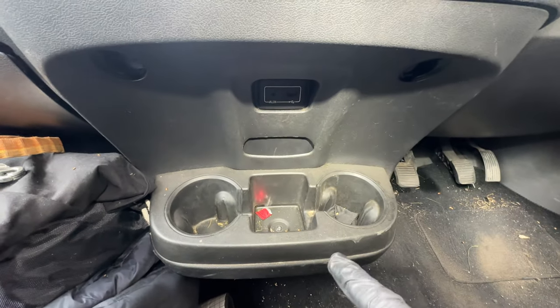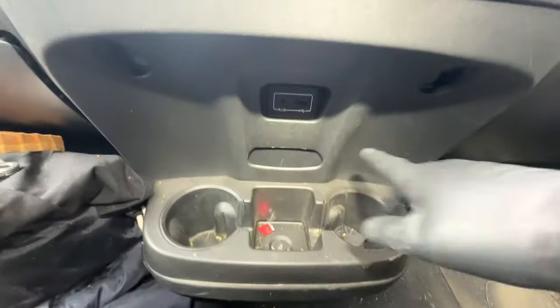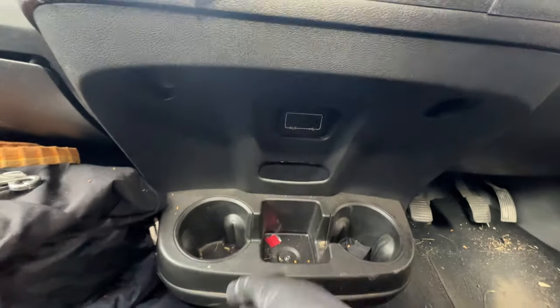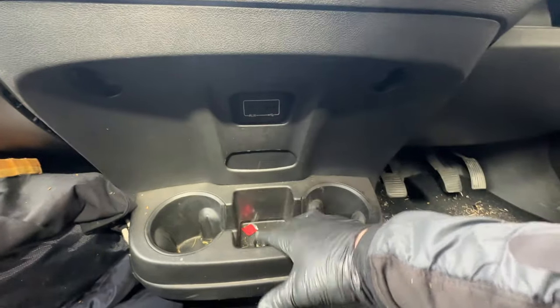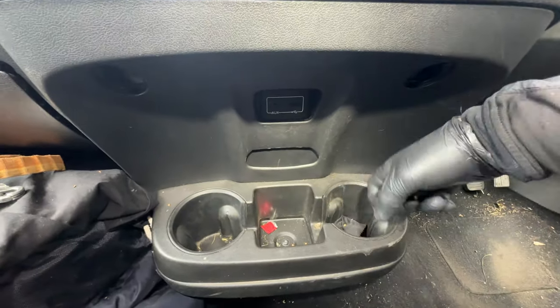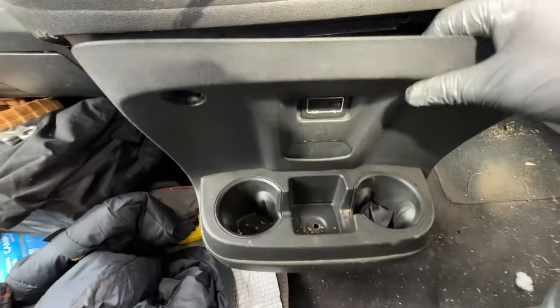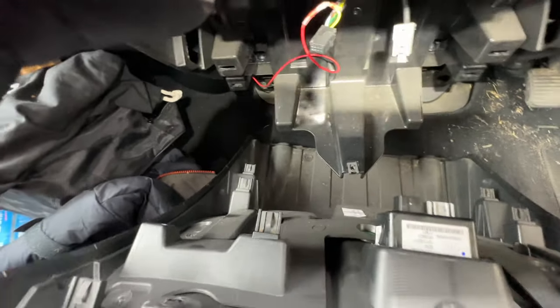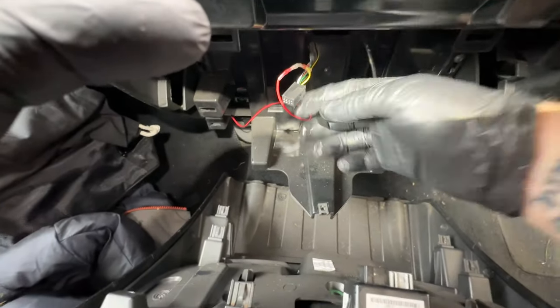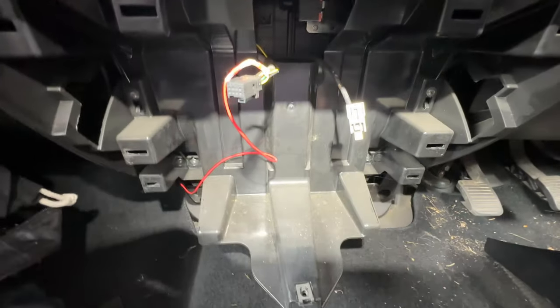This is me attempting to do the pollen filter within the cab. I believe there's one screw in here and then a couple of screws up here which should detach this panel. There should be an electrical wire clip at the back, so that comes off and it should all come out. Just be aware — before you rip this off, release these two wires at the back.